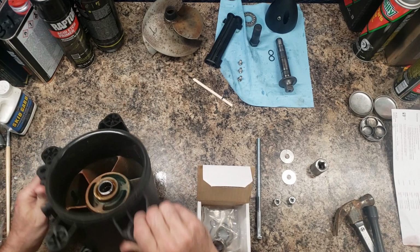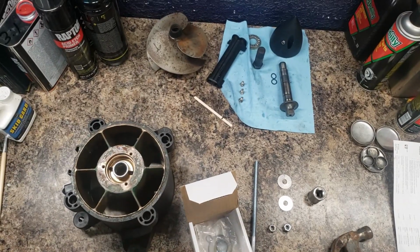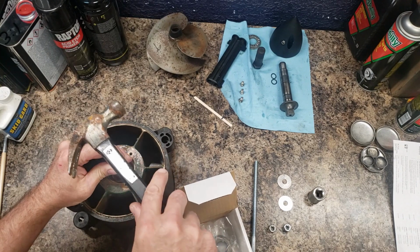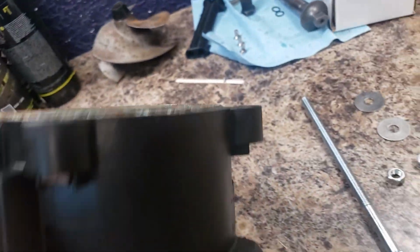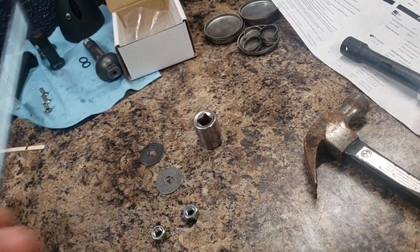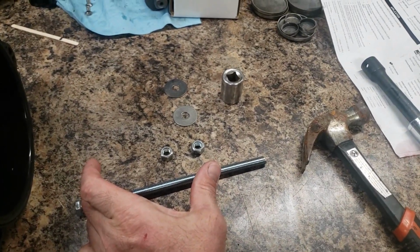That's fine. I'll do the other side here. Like I said, it's oiled up on the inside here and outside of the bearing. All right. Bearing like halfway in there. The other bearing, about the same. My plan is to use the 2 sockets and this bolt to sort of sandwich it together so they're on the same angle.